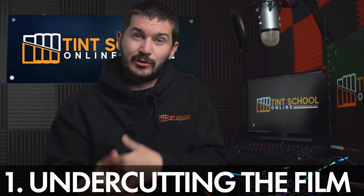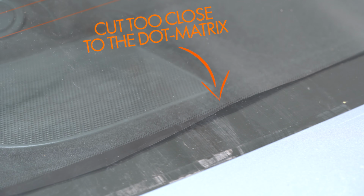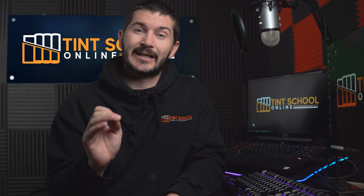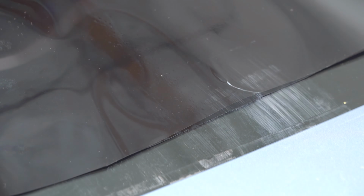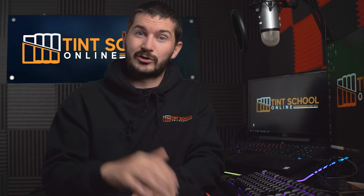So we mentioned in our training tutorials that you should never cut the film short when you are new to shrinking. The chances of creasing the film are going to be so much higher as opposed to when you're more experienced. And the most common places that you're going to crease the film is going to be on the edges towards where the film finishes. And this is because it's usually where the glass curves the most towards the bottom or the top corners.